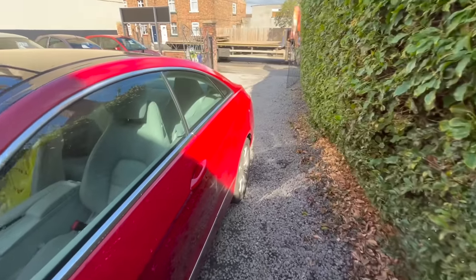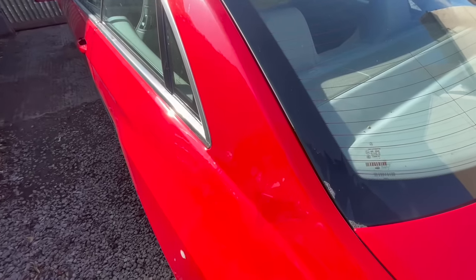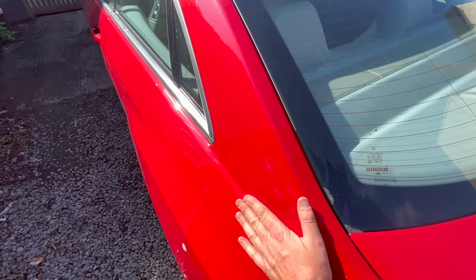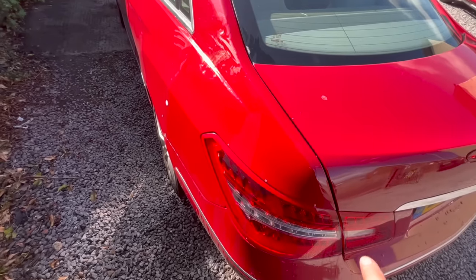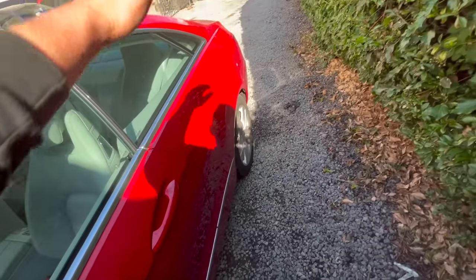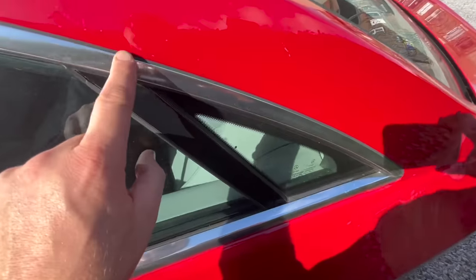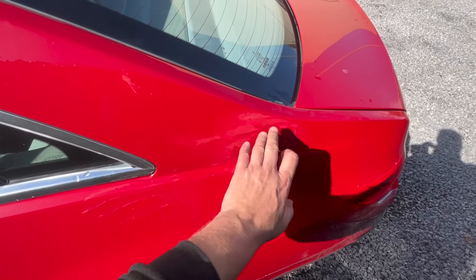So I was going to try and do a spot repair. We repair round this surface area, but it becomes a nightmare. So I'm going to get the block, and I'm going to block this just to stay smooth where the lacquer is, and then it's going to have a small skim, a fine filler over that. And then what we'll do is we'll 2000, no we won't, what am I talking about? We'll 1200 the full quarter, all up here, and then we'll paint the full quarter and just blow a little mark flick into there and re-lacquer it. It'll be easier. It's going to be straightforward to tape up. We haven't got any major issues, so we'll block this off now, and then we'll get some filler chucked in there.